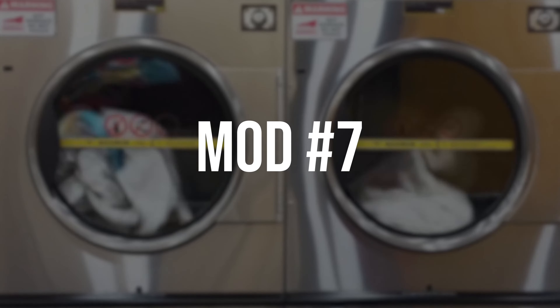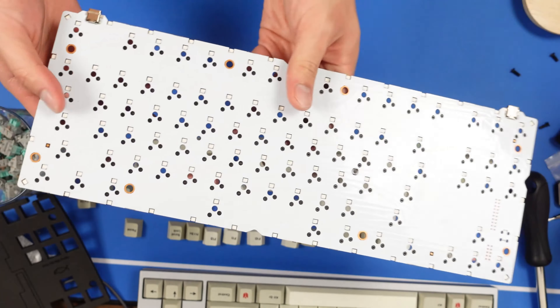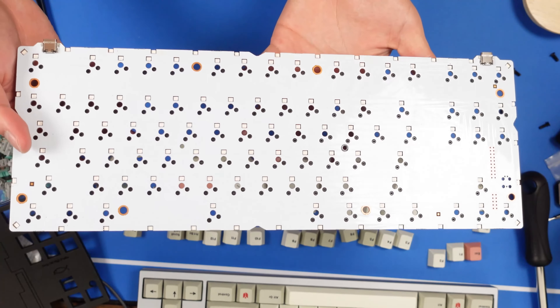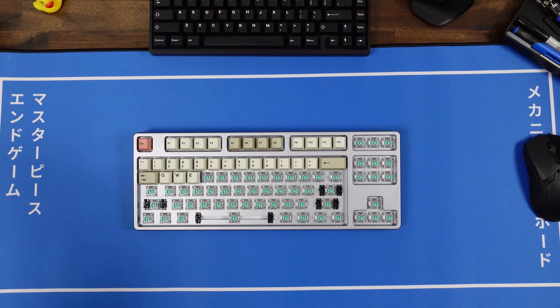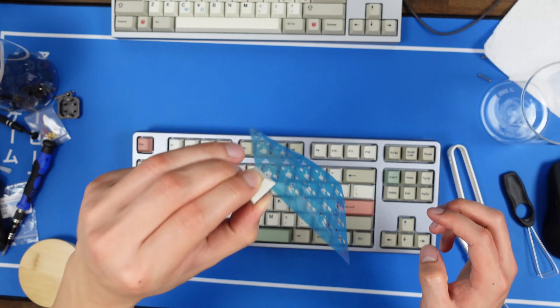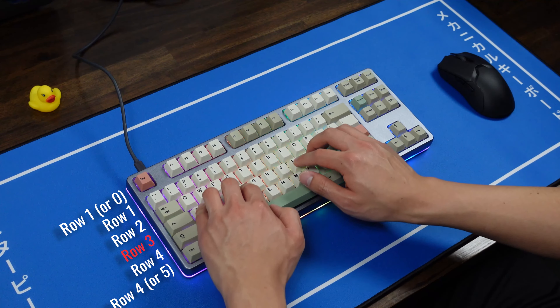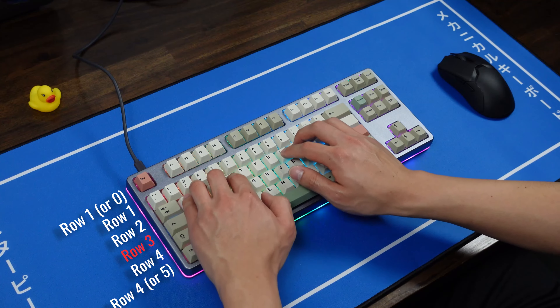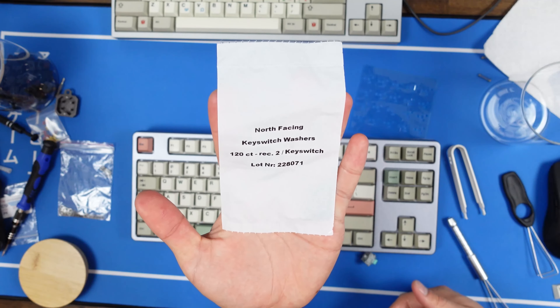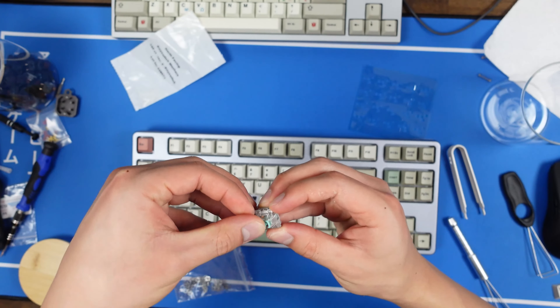Mod number 7: Switch Washers. You may have noticed that the Control PCB is north-facing, meaning that these Cherry profile Artifact Bloom keycaps may cause interference in certain rows — in other words, they may collide with the switches. With these Momoka Frogs, only Row 3 was affected. So I placed some of these washers from OLKB on the R3 switches, and it alleviated the interference completely.